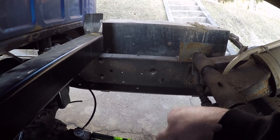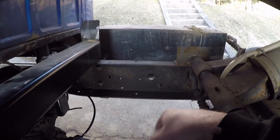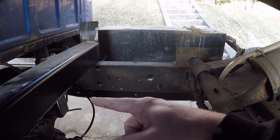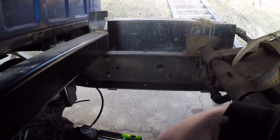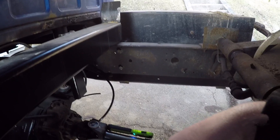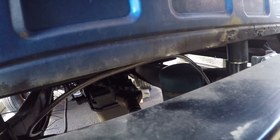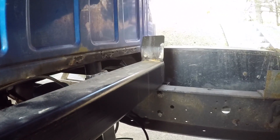I've got the air brake system that needs to be plumbed in, and the governor still has to come back to the tank, plus the venturi for the heating system and the air horns. I still have to find a location to mount the air horns — there might be room up next to the transmission, or if not, I might be able to get them in the front bumper.